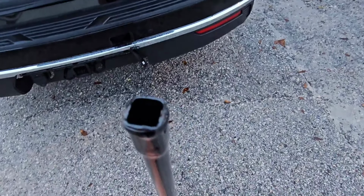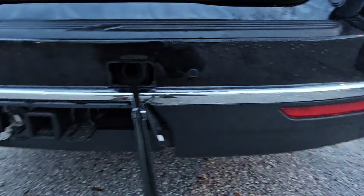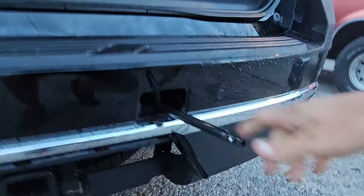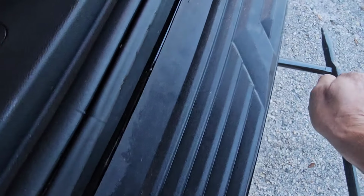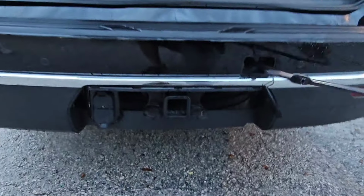And then you're gonna take the big square end and feed it into the little tunnel here. It's going to go in like so, and then you'll feel it go in and engage, and when it doesn't turn, you know it's engaged. Then you take your lug wrench, the big square at the end here is going to slide over the smaller square, push it past that little button there, and that locks it in. And now you want to start cranking it counterclockwise like so.